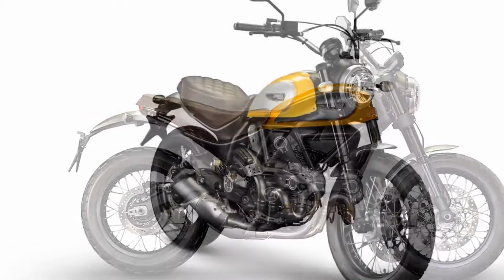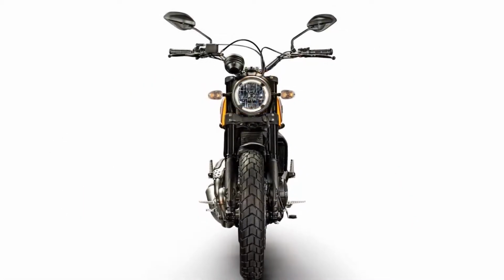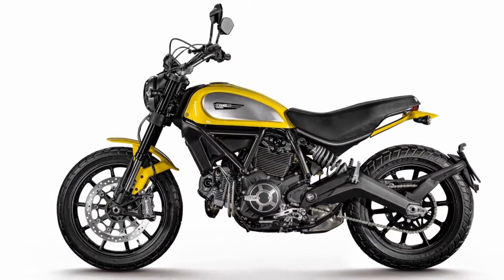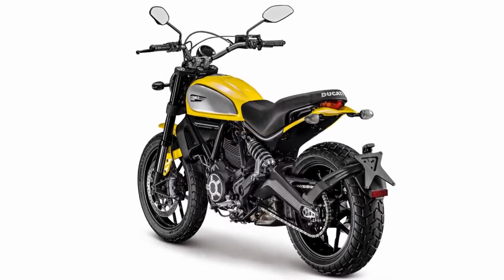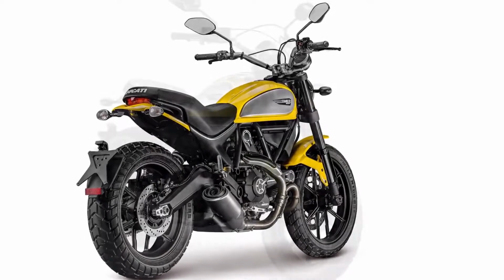Throttle and Flat Track Pro run twin-bore, Termignoni performance silencers for what looks to be a 2-into-1-into-2 system, or perhaps a true dual exhaust with separate circuits for each jug, it's hard to tell. Whichever the case, there can be no question that the Termignoni mufflers certainly look sportier. All this is fine and well, but you know what they say, the proof is in the pudding.